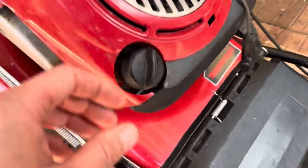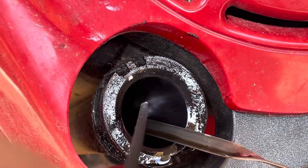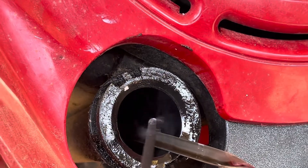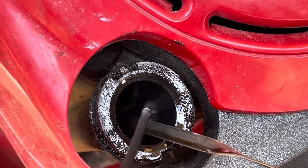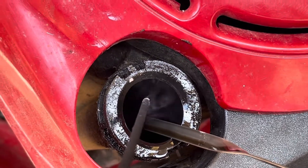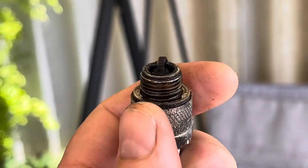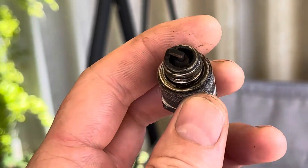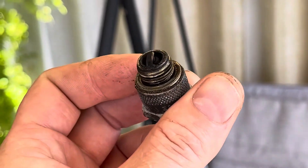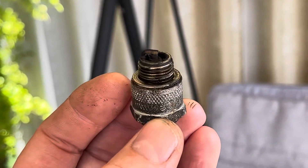Then that leaves — there you go, can you hear that? Can you see how it's blowing out? That's a leak past the rings, which means the rings are worn — probably because it went low on oil, and that's also probably why the connecting rod has started to knock. A quick zoom in on the plug shows how much oil is being burned, passing the rings. It confirms from multiple angles exactly what's going on, so let's tear into it.